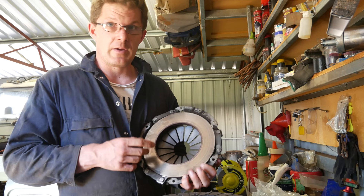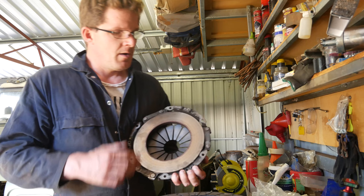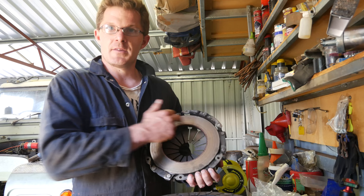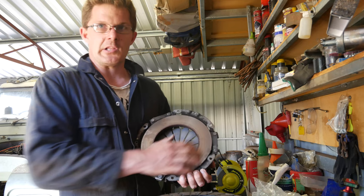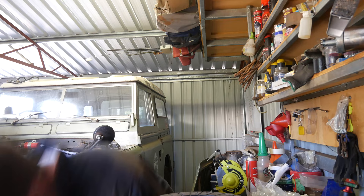If we're going to use a secondhand pressure plate or just touch up the clutch, the rich man's way is to take it to a machining shop and have them carefully mill around it and take the glaze off. The friction material from the plate breaks down to form a powder, creating a glazing effect - a bit like what you get with disc brakes. This glazing effect is one of the key problems, and you get it on both the pressure plate and the flywheel.